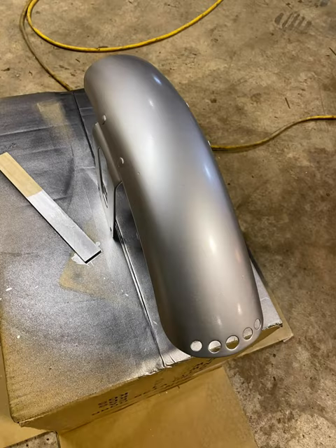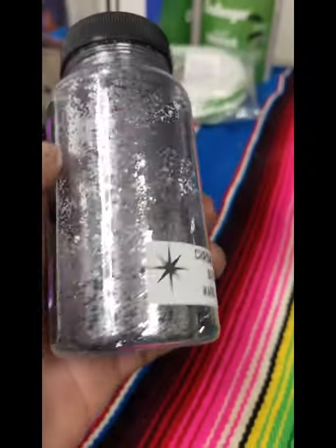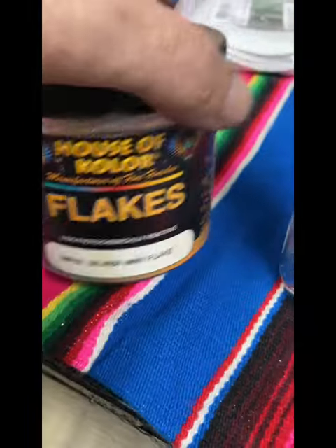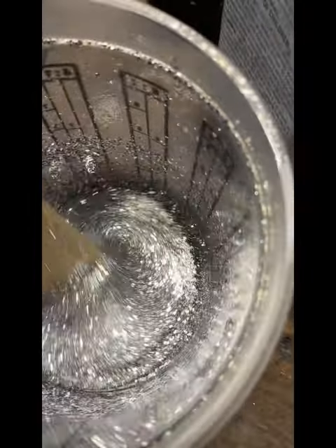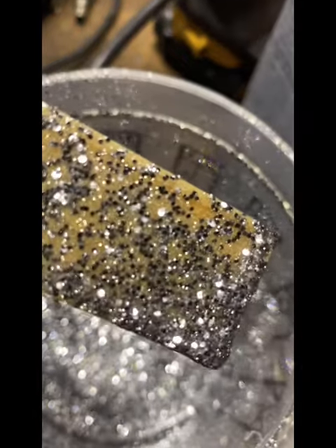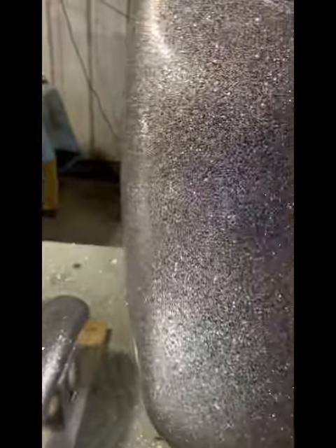You're going to let this flash — don't need to wait too long — and then get the flake ready. This was some .025 Blake's Flake mixed with House of Color Mini Flake. You're going to want to mix this with an intercoat clear. With this big a flake, it's going to have to go through a huge tip, like 2.5 or bigger. I put three coats of this on, just letting it flash in between each one.